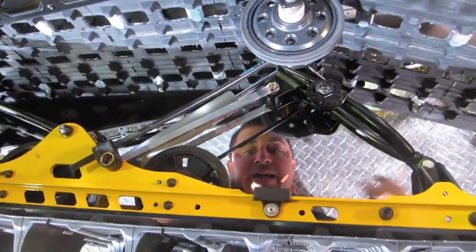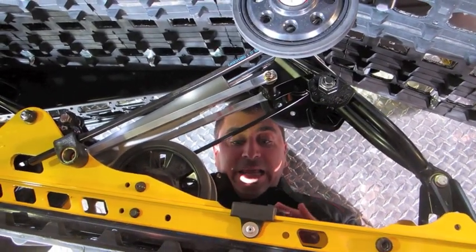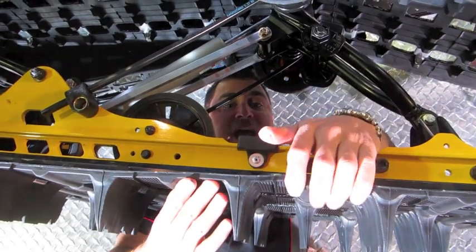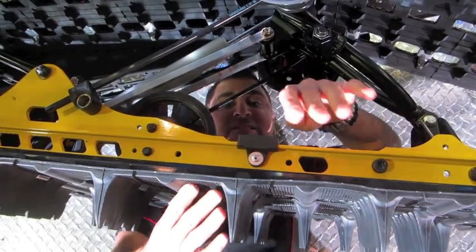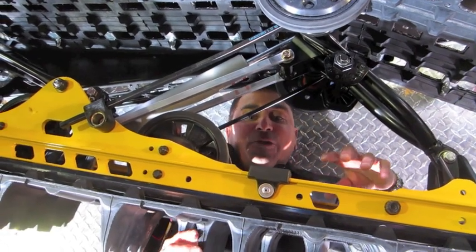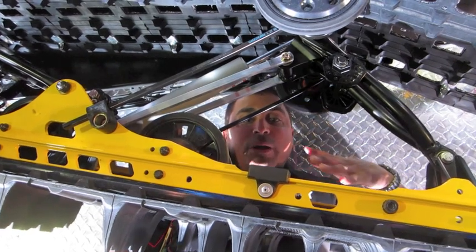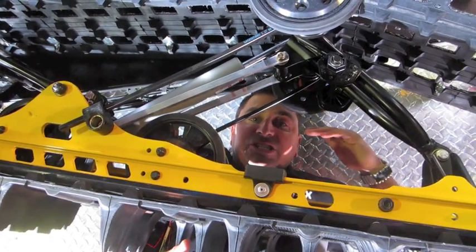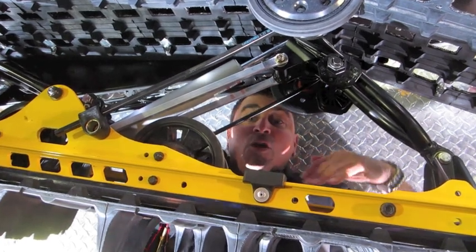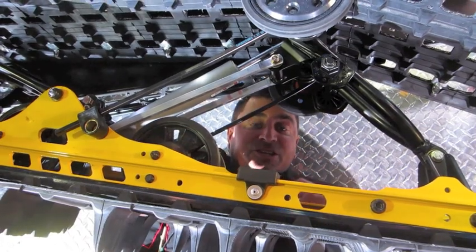In the track, where we had a 16-inch long rod that went right through the track, it's now been reduced to 12 inches. So now the outside of this track can flex a little bit. Some people are skeptical thinking it won't hold a good line, but I've ridden this sled and it's amazing — it allows it to just roll over so easy, it actually grips the hill better. It just stays right with you no matter what type of side hilling or uphill carving you're doing through the trees. Amazing innovation from BRP.